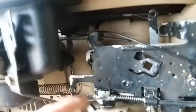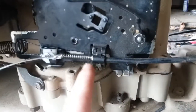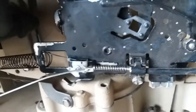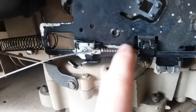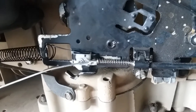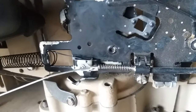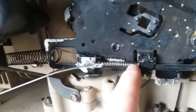For my spring tension setup here, I had to play with this a little bit. I went through a few springs because I bent them or broke them. The brake line runs down to here, right where the factory clamp is, and I put this spring. This spring is the spring that operates the clicking sound on your click pen — believe it or not. I took the spring out of a click pen, stretched it a little bit, and it fits perfectly right there.